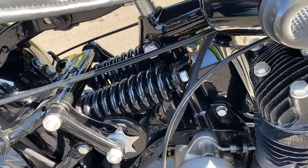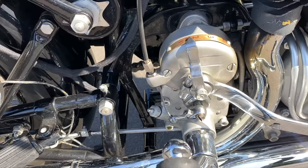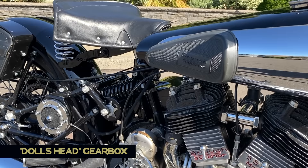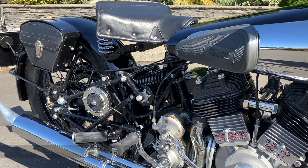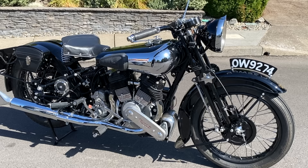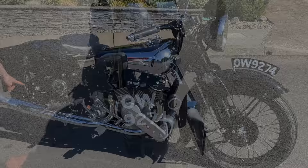These are the standard Dunlop rims from the time, but the brake hubs are actually from a Royal Enfield. The gearbox is mated with what was originally a design from Sturmy Archer — you may remember that name from three-speed bicycles. This gearbox is also known as the doll's head or the positive shift selector gearbox. Originally a three-speed transmission from the 20s for Brough, the design was later acquired by Norton, who evolved it from a hand shift to a four-speed foot shift design.